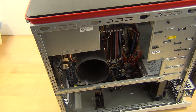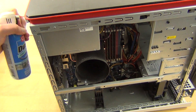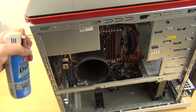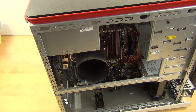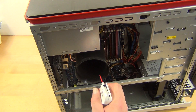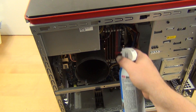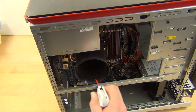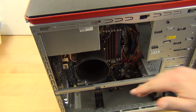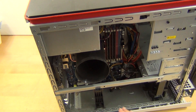Basically I'm going to work my way down the system. You want to get in your power supply — that's definitely a place that's going to benefit a lot from being dusted. And obviously the CPU fan and all of that. So now I've got most of the dust migrated down the board into the bottom. At this point I'm going to take it outside.